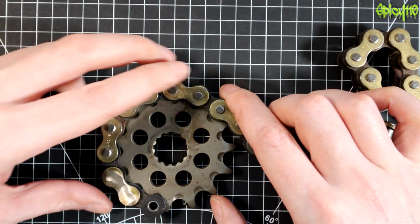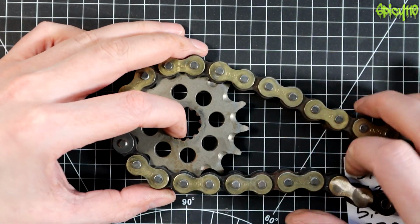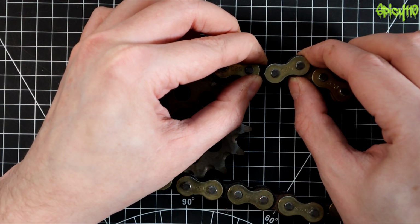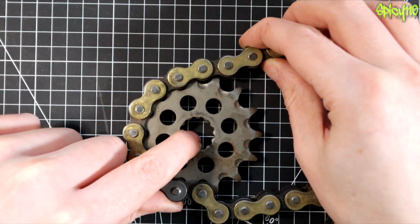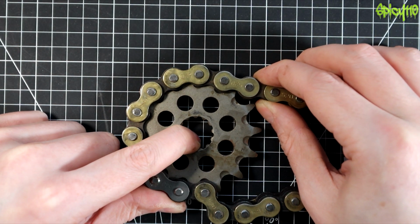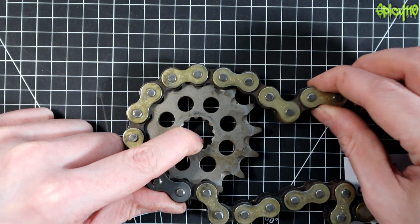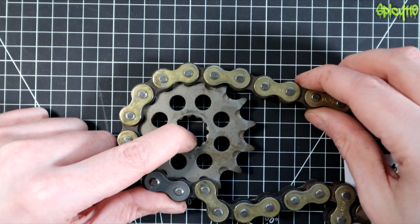What I think happens is, obviously the tightest radius a chain goes through on a motorcycle is the front sprocket. So it would be like this on your bike. When that stuck link that doesn't want to turn gets pulled through here, it's going to get turned. And if it refuses to turn, and that happens at a point where it's done it many, many times and it's starting to fatigue this, or your chain is loose and it's whacking, because shock loading over time can cause the crack to form and then it just goes at some point.